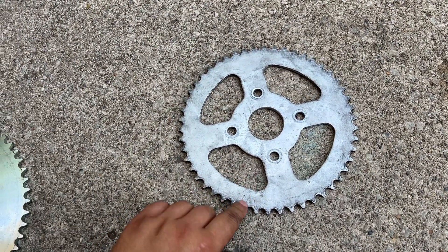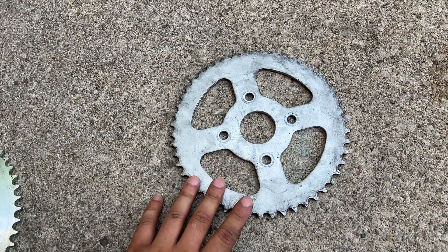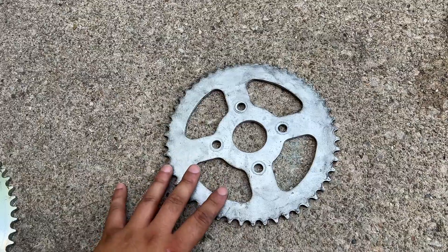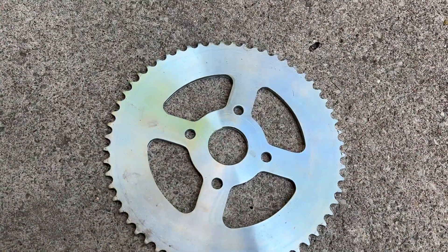What is going on guys, Nick here. Today we are going to swap the gears on the Coleman. We're going to change out the stock rear sprocket and throw on a 60 tooth, and we're going to change out the stock 10 tooth front sprocket in the torque converter and put in a 9 tooth. This is a stock sprocket off of a CT200U, BT200X, Baja Warrior, Massimo MB200 — 52 teeth. Usually on these 19-inch tall tire bikes, 50 to 52 is standard. And this is a 60, and we're going to compare the two.